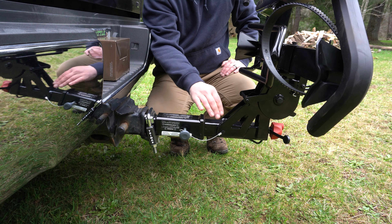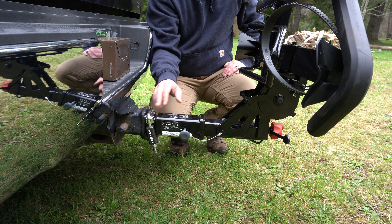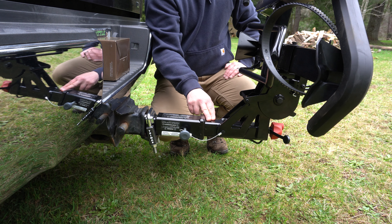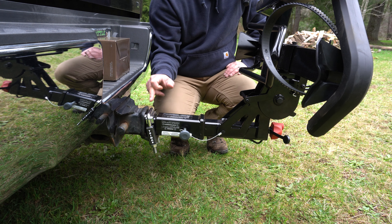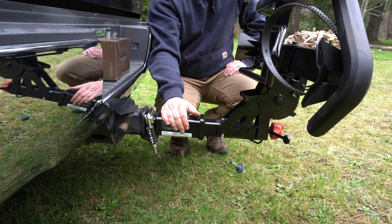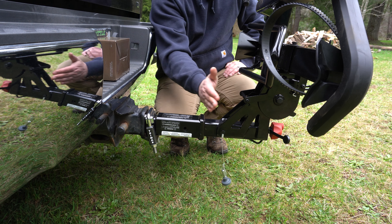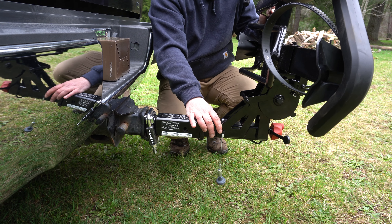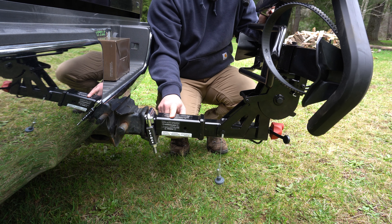Because of the design of the tray rack itself, I had to get an extension. The reason I had to get an extension is because I have a two-and-a-half-inch receiver with that reducer piece in there — this rack is designed to clamp against that. What we found out from the other video was that even though the clamping mechanism worked and clamped to the receiver, because there wasn't a through-and-through pin, it just grabbed hold of that reducer piece and it slid right out. So that's why I had to get this extension — it's a seven-inch extension, which is what is causing this to sit so far out. Part of the design purpose of having that clamping mechanism is to keep the rack from rocking around, but that only works between those two pieces. I actually ended up having to get a clamp to prevent this piece from rocking around itself.